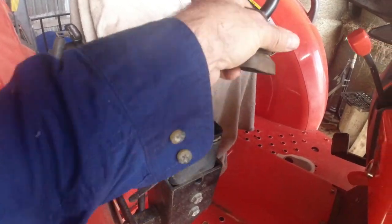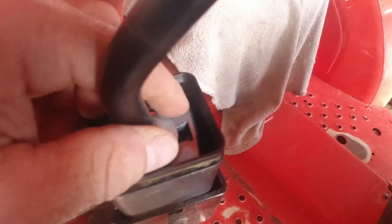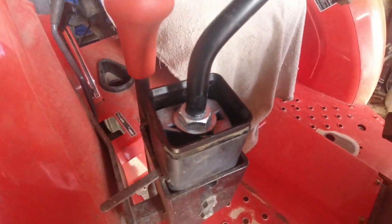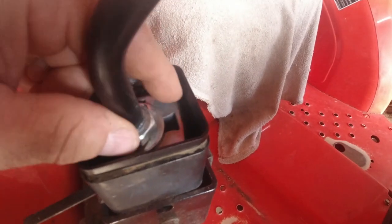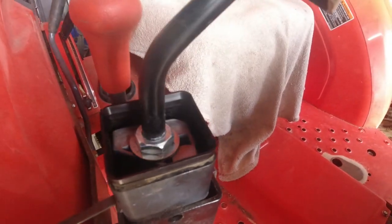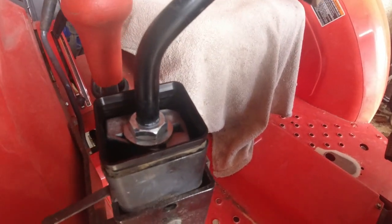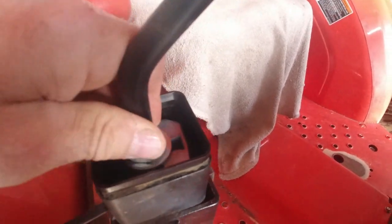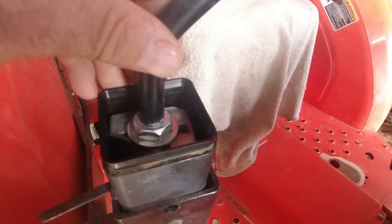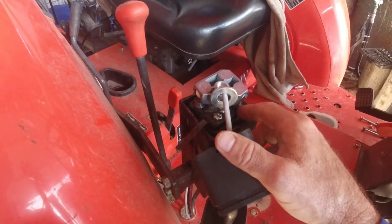This controller here, inside this sock section - I'll just remove it. Inside there are three ball-and-socket plastic or nylon bushes. This has just had its 250-hour service yesterday, and probably 40 hours ago one of those nylon bushes actually broke. I've unscrewed the joystick and this cover slips over this section here - it's held in by a pin, so I unpinned that.